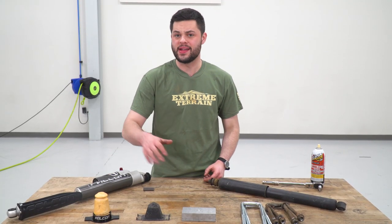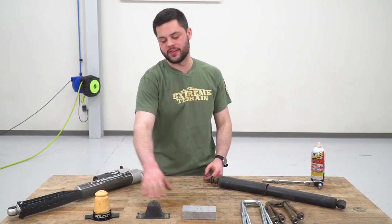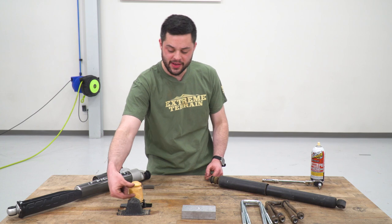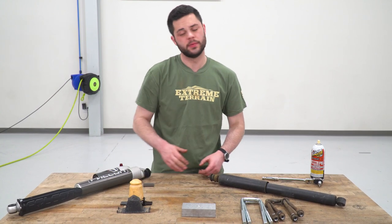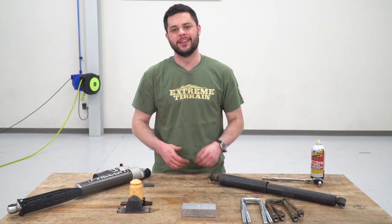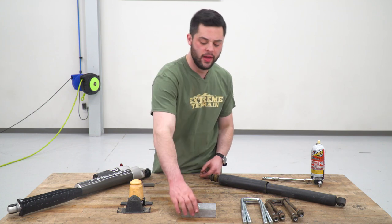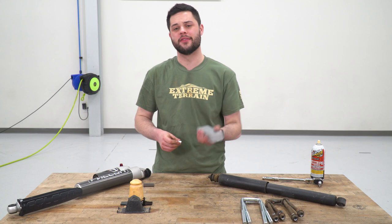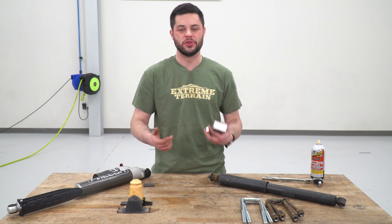So now we're all set, and with that foam part installed, you can see the height difference in these bump stops. Put the two behind each other like that. You can see our new one is gonna be just a little bit taller. But that's gonna do it. Time to hop back to the install. We're gonna need our rear lift block, obviously, and this little alignment dowel to make sure everything lines up. Then we can bolt it down with the new U-bolts.